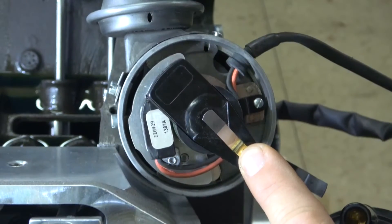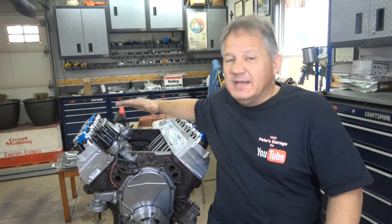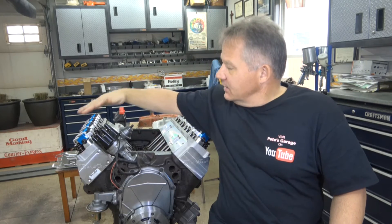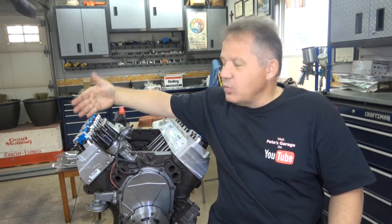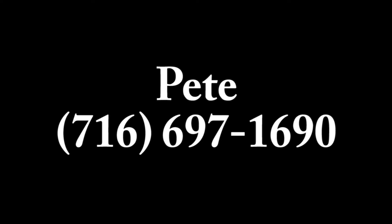The rotor is in the intermediate shaft, and it's all timed correctly. Putting in and timing the intermediate shaft before you put the intake manifold on makes it a hell of a lot easier, so that's why I do it now. That makes sure that you have the timing right, the distributor is installed correctly, it's pointing towards number one, and you're all set with piston number one at top dead center. So when you go to start it up, it'll start up immediately and you won't have to hunt for the timing. That intermediate shaft timing is very important, and I hope that helps you out. Thanks for stopping by Pete's Garage, I'll see you next time.